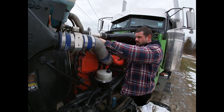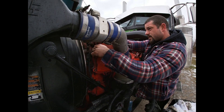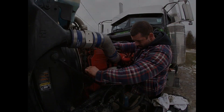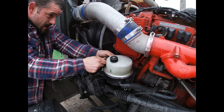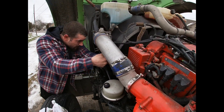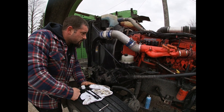You just start putting everything back together the same way it came apart. These little bolts won't come out, so I would recommend hand-starting all of them — you don't want to have to replace the whole housing if you cross-thread anything. We're just tightening all these up. This is just a plastic housing, so you don't want to overtighten anything.